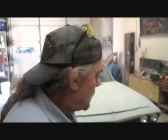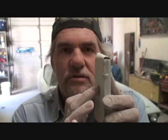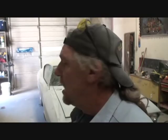So what we're doing is we're still block sanding the car. Now I'm still using my soft block, which is a flex block, and I went ahead and transferred over to 180 because now I'm sanding the roof. Now, if you remember correctly, we block sanded this car down when it first got here. We had the other guy block the car out with 80 grit. Now, I'm going to go ahead and explain that to you. The paint job that was on this car was very, very old, but it was in real good condition.